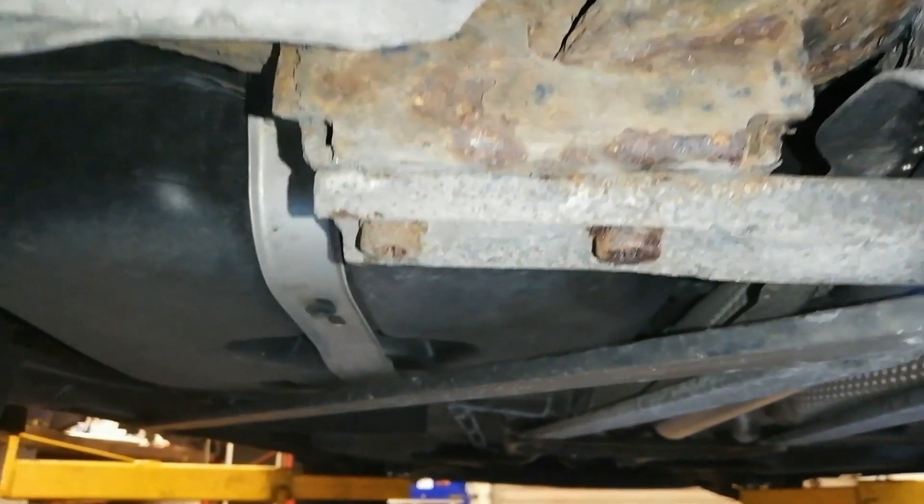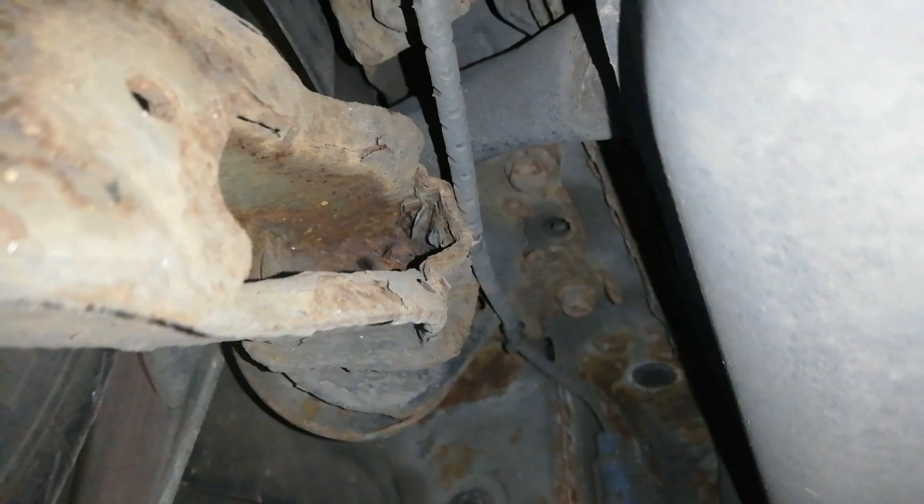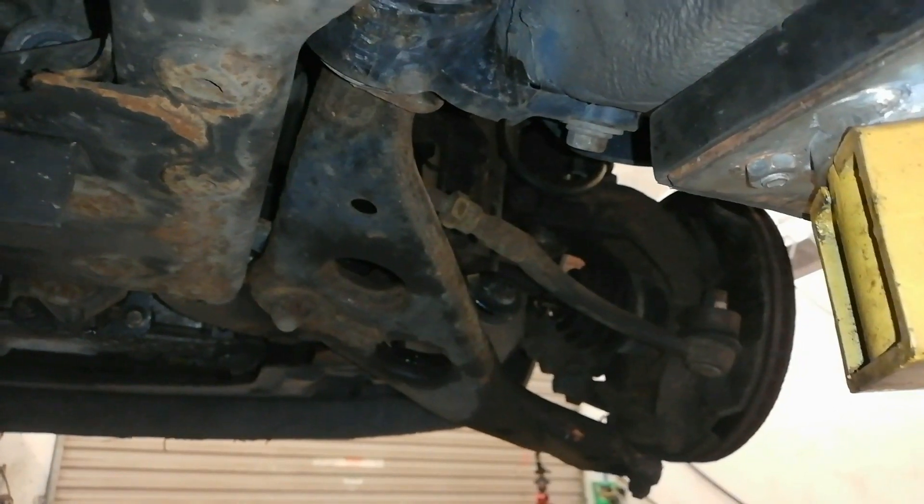Let's see if I can scoot along here. It doesn't look too hot up in there either. If I follow that line along - that's the fuel tank filler there. There's more corrosion on the brake lines. So this car needs brake pipes, basically. Back towards the front of the car again, I'll just show you an Achilles heel of these BMW Minis - these bushings here, bolted onto the body and up on the subframe on the other side.